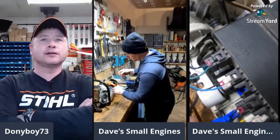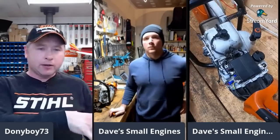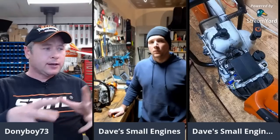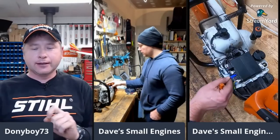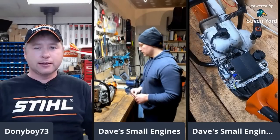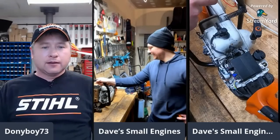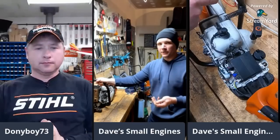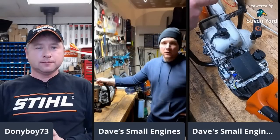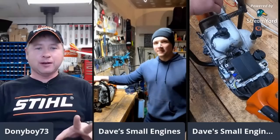So what I do, Dave, is I have a saw or two in my collection. And if one comes in the shop, I basically just take the module from the spare parts saw where they blew the top in — from not changing the air filters. I keep all those electronic parts and then when a saw comes in, I just take it off and try it. But there's still another thing you need to check here. Did you have another parts saw from a buddy or somebody? I can see if I can find one. I just have a hard time thinking that it's the control module because it's got such little use and it's a sealed unit — it's meant to handle water on the saw.